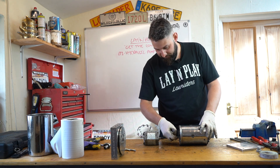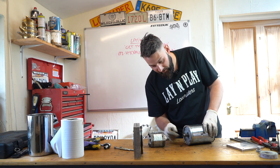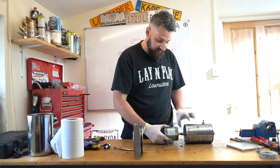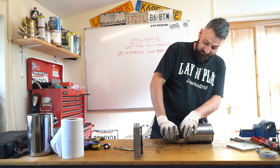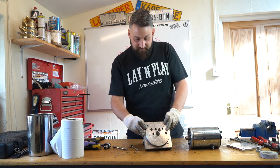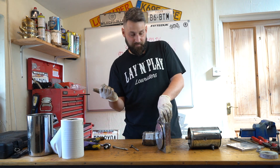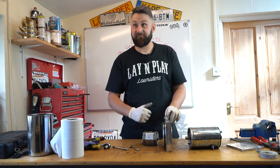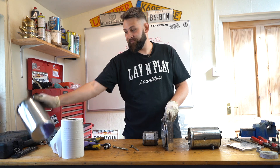On the end of your motor there's a little keyway, and it just sits inside the two slots there - it fits onto the motor, through the block, and the other side fits on the gear. So when your motor is spinning, when it's being energised, it's spinning this key, which in turn spins the gears inside the pump head, which takes the fluid back through this little hole - which if you remember had the broken o-ring on it. Through that hole is where the o-ring sits and up through that hole out. The hole on this side is just your return port - so when you hit the switch down and it energises the dump, it doesn't spin gears or make the motor work, it just energises a coil which opens a valve allowing the pressurised fluid from your hoses back through that return port, which is a straightforward hole that fills your tank back up.